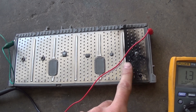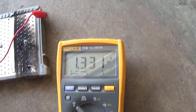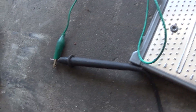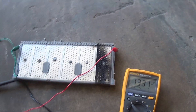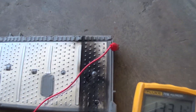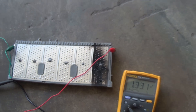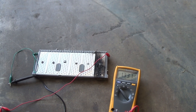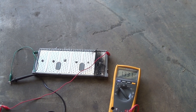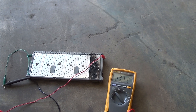As you can see, this module is only holding about 1.33 volts — that would be the problem right there. With alligator clips clamped on, that's the actual voltage of that battery. I'm not sure why it appears to have burst into flames, but that's actually kind of good news — it shows that one battery catastrophically failed rather than just gradually wearing down. It was a clear point of failure.